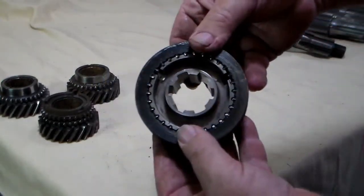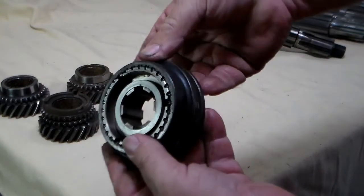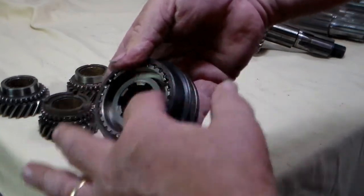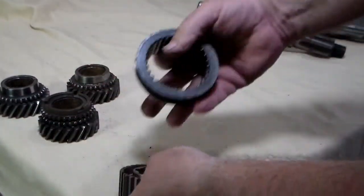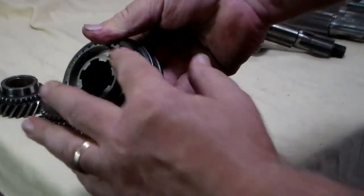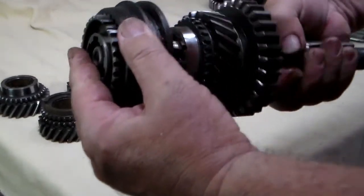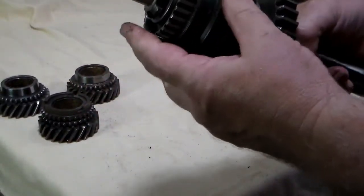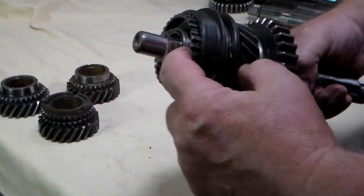Notice I just put this on here this way — I'm going to point this out again during the rebuild portion, but I'll point it out right now. This is the wrong way for this assembly to fit together. This wide and shallow part should never be on the front side of this sleeve — it will fit that way, but when you go to put everything together it's not going to work. The skinny one that fits out flush — that's the one that goes here. When this goes on, everything fits together like that, with a blocking ring and a snap ring in here. So those are all fine.